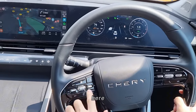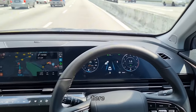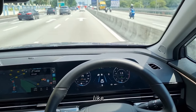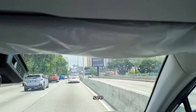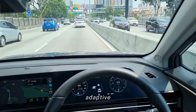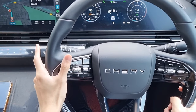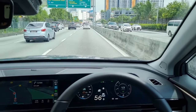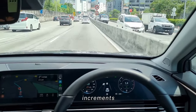The adaptive cruise control is controlled here on the left side of the steering wheel. You have six buttons here. These two are the speed setting — press plus to increase your speed and press down to decrease your speed. Right now I have the cruise control already activated. You can see that when the car in front brakes, this car brakes as well. To activate the adaptive cruise, press this button right here — the A with the steering wheel icon. Press once and it will activate and set the current speed you're going at. So 56. If you want to increase the speed, you can hold this down in increments of five, and decrease in increments of five as well.